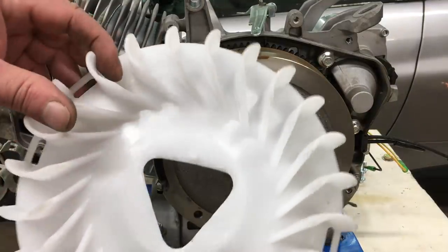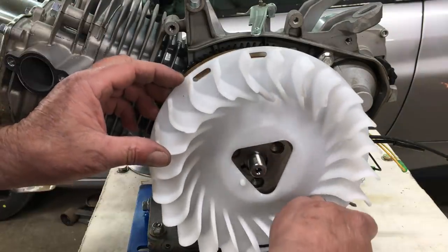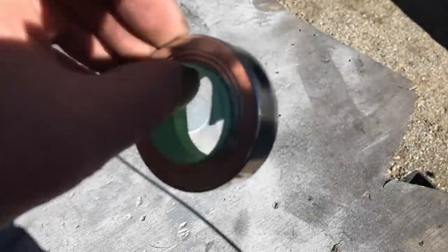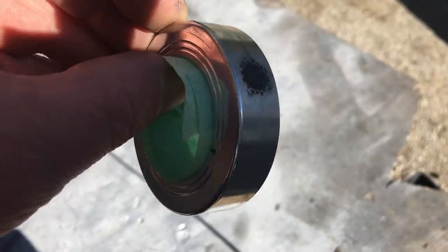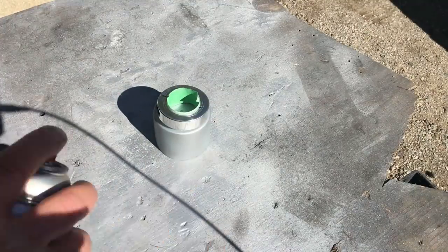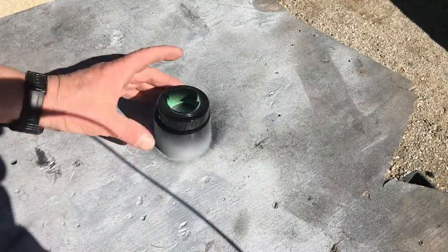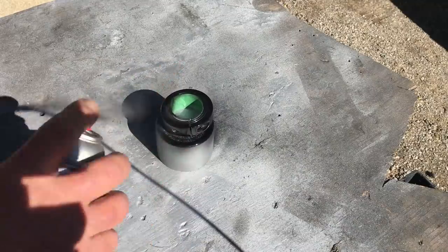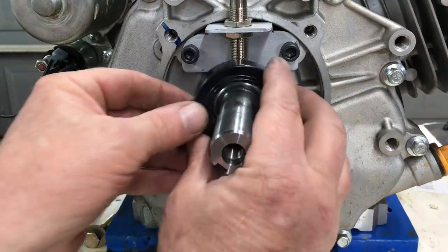Let's take a look at the cooling fan that came with this engine. It does a great job keeping the temperatures low — technically this engine shouldn't be in the car in the first place, but it seems to work. There was talk in the comment section about the neodymium magnet I put on the shaft collar, and the theory is it may eventually fail due to heat. So once we get the car up and running, I'll shoot it with an IR thermometer to check the temperature. Shiny aluminum can give a false reading with an IR thermometer, so we're going to paint the shaft collar black.